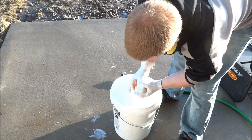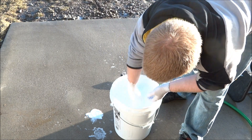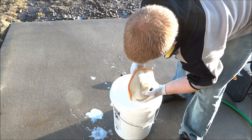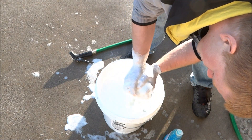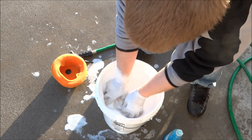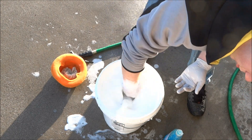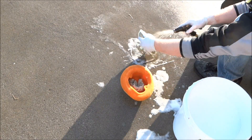Right after you're done cleaning the filter and cage in the solvent tank, put it right in the bucket with the soap and water. Just dip the filter in about five or six times and keep squeezing it until the water coming out is clean. At first you'll notice the water coming out is pretty dirty — it's amazing how much dirt comes off the filter in this process, so it's a pretty important step.